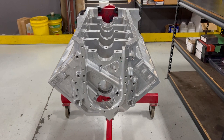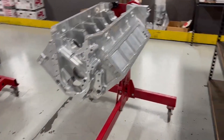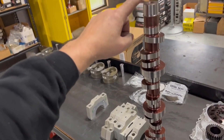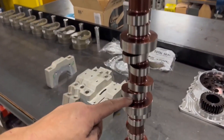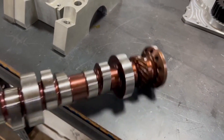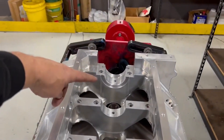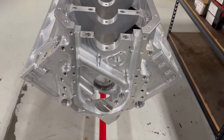I'll grab the camshaft and we'll test-fit it before starting on the crankshaft stuff. Here is the 65 millimeter camshaft. If you want to know more about it, see my camshaft videos on Steve Tech. You can see the small journal up top for that rear roller bearing, then babbitt-babbitt-babbitt-babbitt-babbitt journals, then the front nose with the distributor gear for turning the fuel pump slash cam sync. The timing gear sets one side of thrust, the rear roller bearing sets reverse thrust, and the front bearing — which I'll show you later — sets the front camshaft thrust.